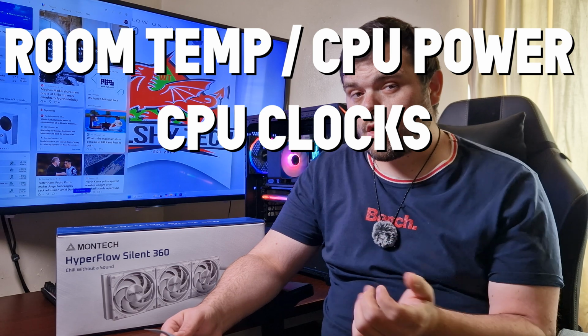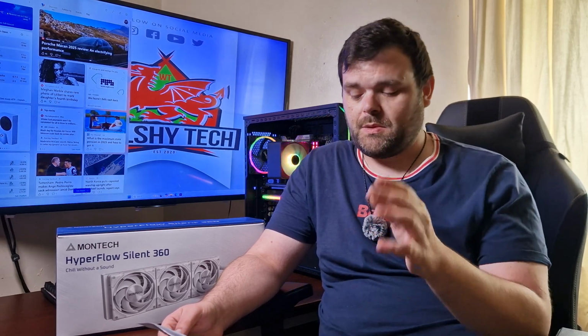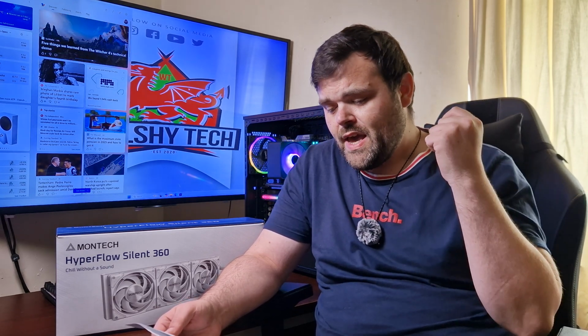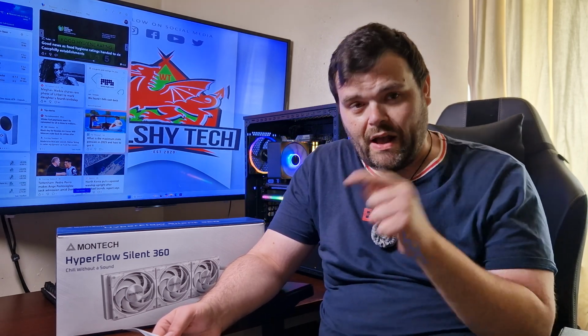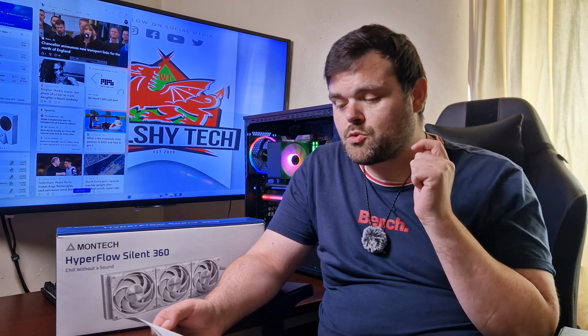So when it comes to the overall testing method, just my normal run of benchmarks: Cinebench R23, Blender Pavilion, Blender Classroom, and 3DMark CPU test. The room temperature during testing was a little bit chillier than previous reviews. It was at 12 degrees before testing, but did go up to 16 Celsius after testing was finished. That was both runs. Now, for 50% fan speed, the CPU power draw at high was 170 watts with a lower of 161. The CPU clocks were high at 5.4 and low at 5.